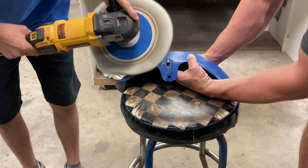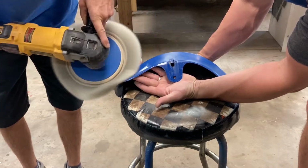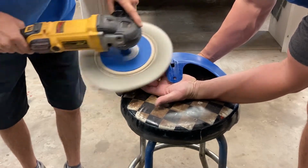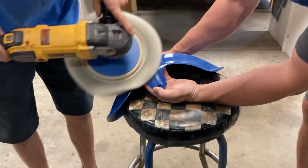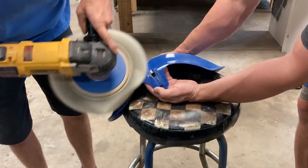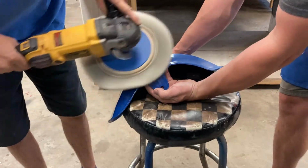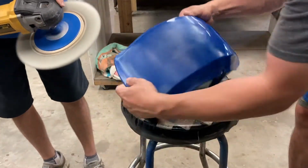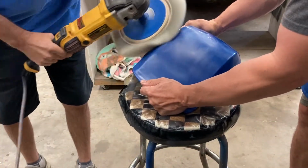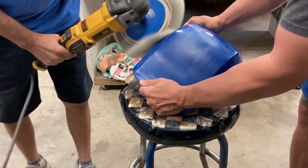We use basically heat and a little bit of friction and a little bit of skill to do our buffing process. From here you can see how quickly even the worst fenders start looking better. And this is a process you can use on almost any ATV, just a dry wool buff. Now obviously if it has scratches, you're going to have scratches, but it will bring the shine back to almost any color you tinker with.